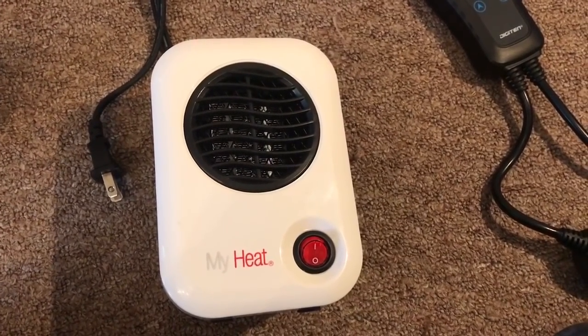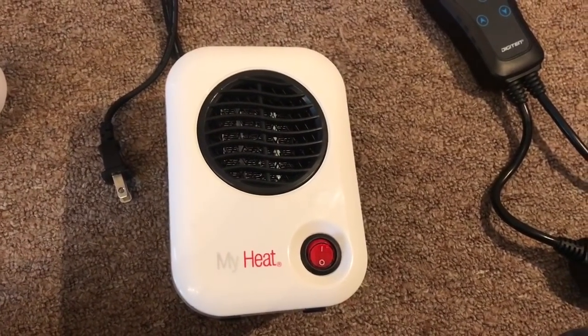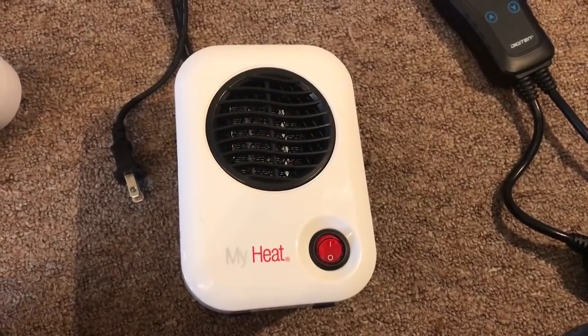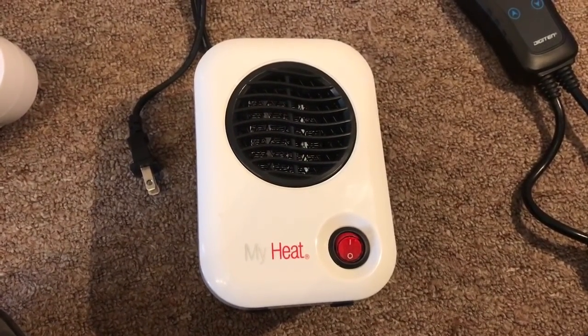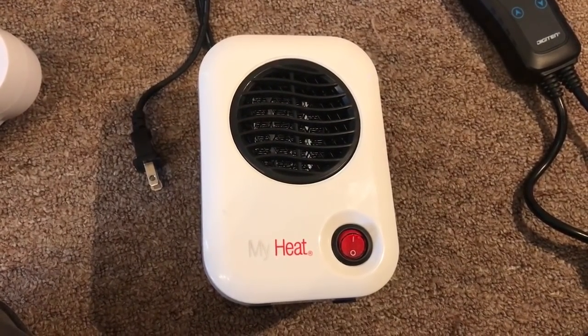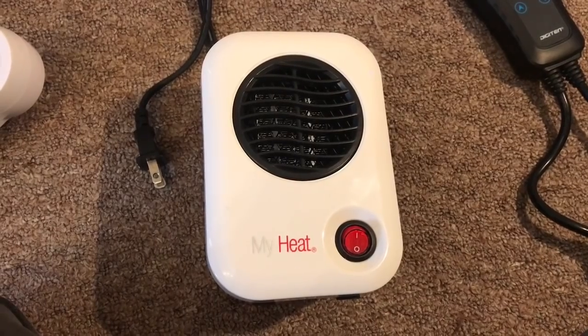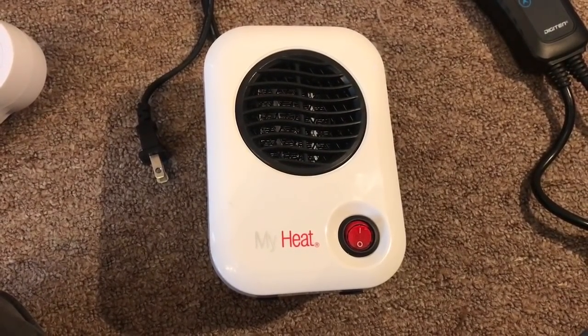So there's lots of pluses and a few minuses, and one of the minuses is definitely fixable. The first thing that you'll see is it's 110 volts and it uses 200 watts, but that's something you could work around. By adding a thermostat, which I did, it's going to cycle on and off. So how much power it uses is going to depend on what kind of temperature differential from inside to outside, how warm you like to keep it. Are you going to run it all night? Are you just going to run it in the middle of the night or in the morning?